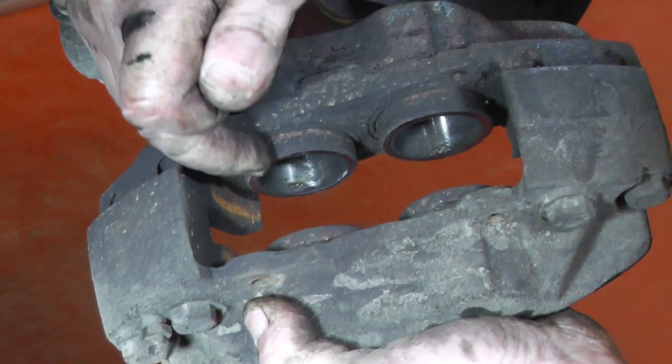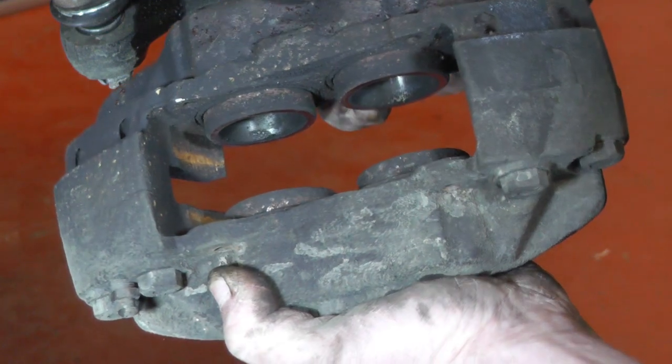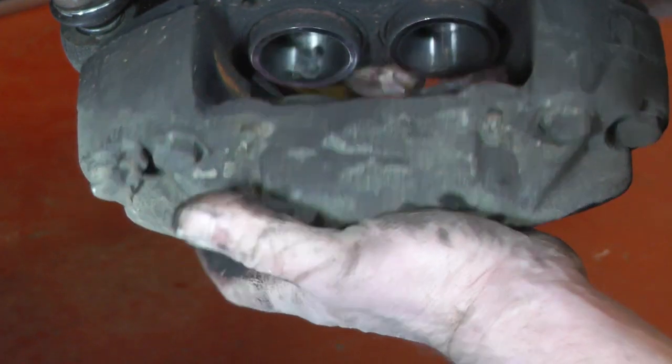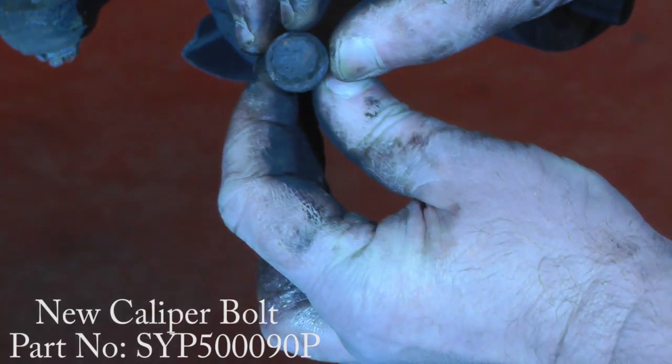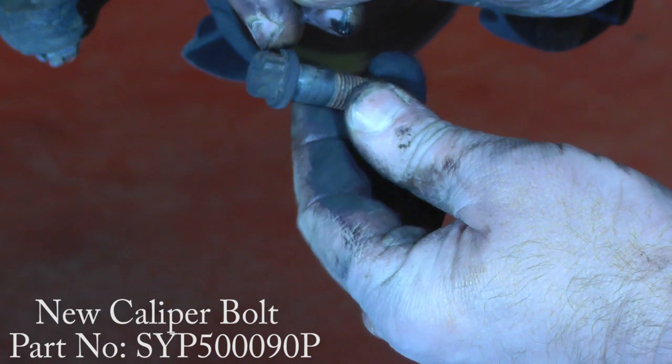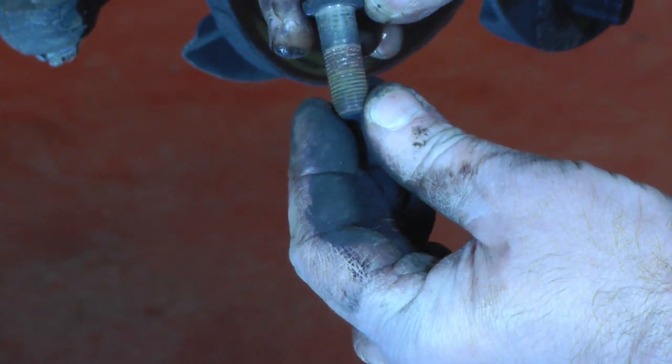As you can see the pistons are now more clearly visible and they're very very corroded, so it's definitely worth putting in new calipers, especially at the price from Rimmer Brothers. This is one of the bolts that holds the brake caliper on - you can see it's not a conventional nut head, it's the double hex one. They do corrode quite badly and get really really tight, so I would definitely put new ones in.